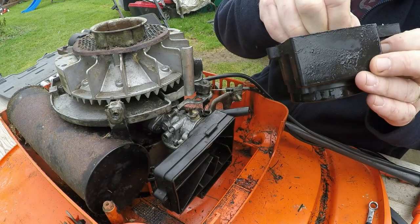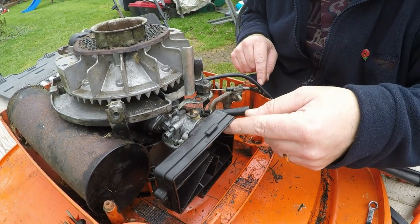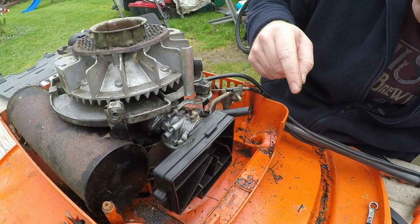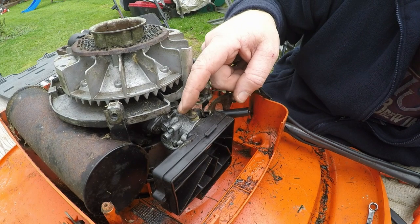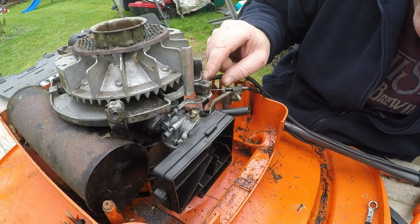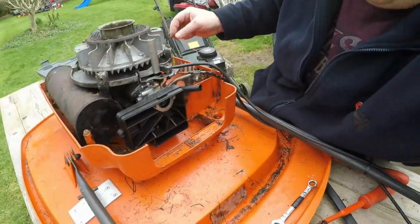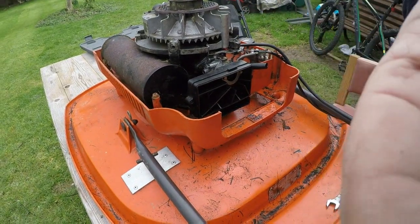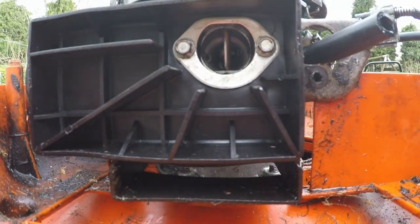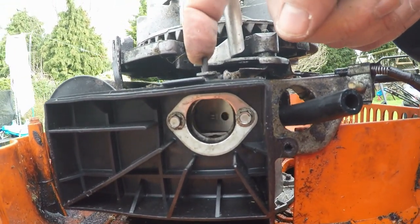In fact it's had a brand new air filter in there, so that's good to see. Let me check the choke - I put it to choke, which it wasn't choking before. Yeah, that's not doing the right job - it needs to be set differently when we get it running. That's not actually setting the choke. Let me make sure you can see it - that's on choke now on the lever and it's not actually activating that choke button at all.